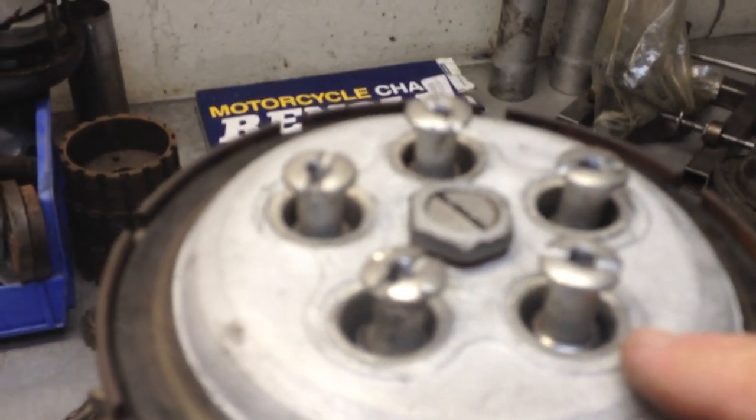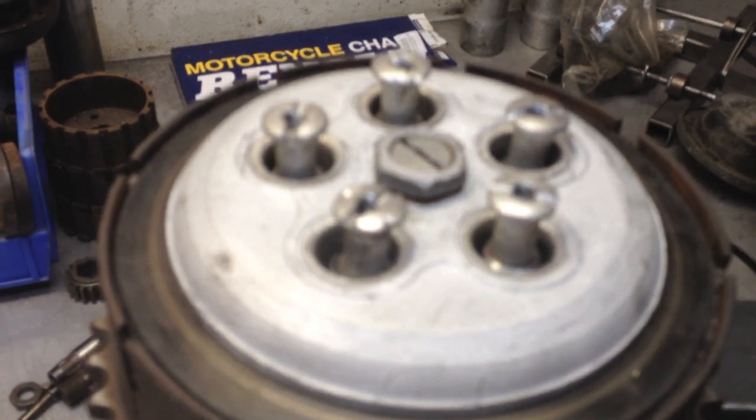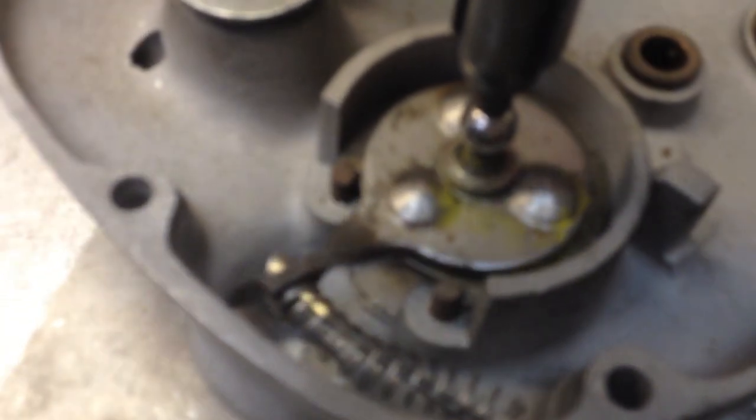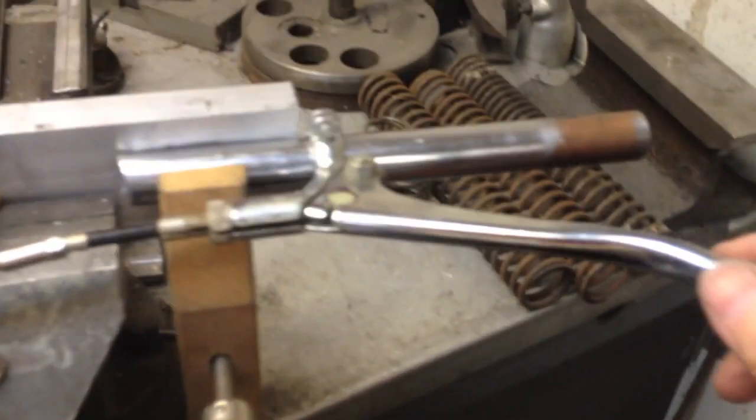I have the B-52 cover. There's an extra spring I put in here because I'm using really light clutch springs — not the standard clutch spring — simply to make it easier for me so that when I operate the lever, I can do it with one or two fingers so you can see the movement. The throw-out mechanism is pushing on a ball like it normally would be, then there's a push rod going up through the shaft, and all of this is driven by a clutch lever.